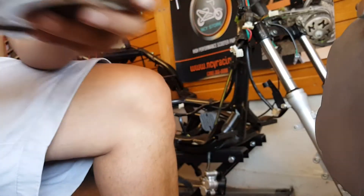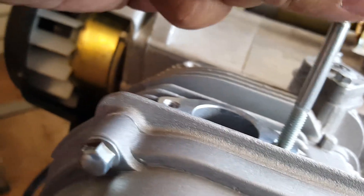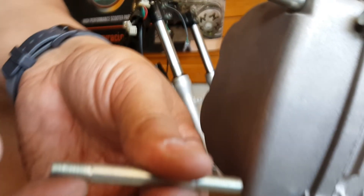There we go. Again, these are pretty loose, so don't think that it's going to be that easy just to use your hands. You will need some kind of vice grips. You can also use some thread tools they have — you can actually lock on with threads. If you're going to plan to keep it long, you can put some blue Loctite on the ends as well and keep them in there. Keep in mind that the longer stud ends will actually go inside the cylinder head and the shorter ones will be coming on top, pretty much for your lug nuts. And these are about 10 millimeters.